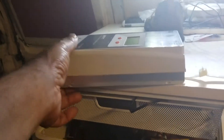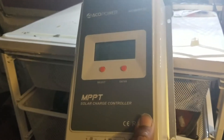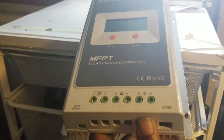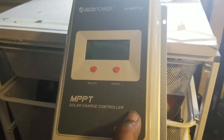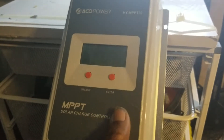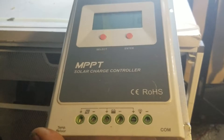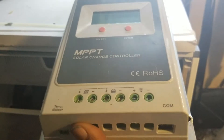I really hate doing these videos twice, but sometimes you just screw up. This MPPT controller is one I've been using for most of the lifespan of this van. It's 30 amps, which was fine when it had a couple of panels up there. But now I have five panels and it is posing a problem. I bought another charge controller — I think it was 50, maybe 60 amps — but it bombed out and I had to put this one back. I just wasn't thinking about the fact that I probably have an under-capacity solar controller for the panels I have on top.